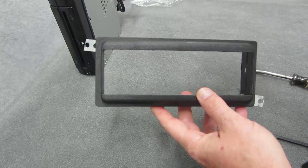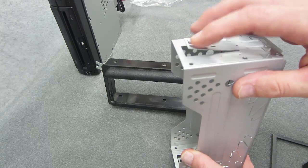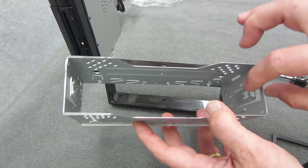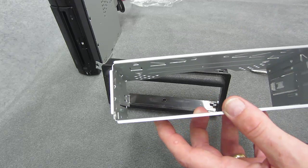In this case, these little tabs that you pushed out so we could slide the deck out — you want to slide those back in and make sure they're fairly well aligned straight. That way when it locks back into the receiver once it's installed, you slide it back in and it's supposed to click into these tabs right here and here. That's really important. Top and bottom don't matter because there's no differentiation on this particular unit, and in most units I don't think I've ever seen one that differentiates top from bottom on the sleeve.